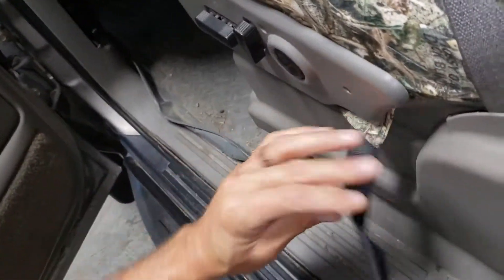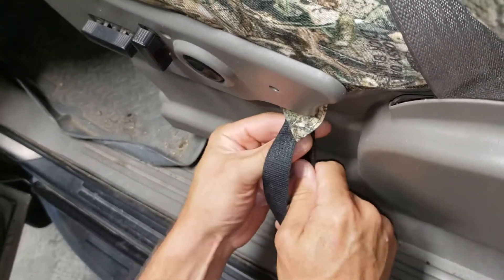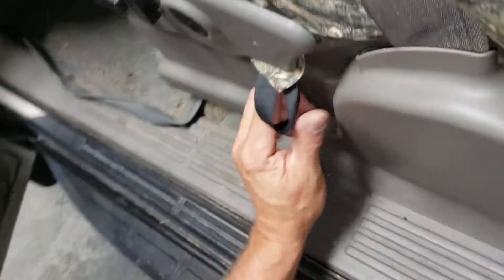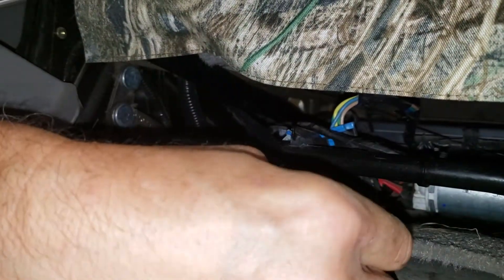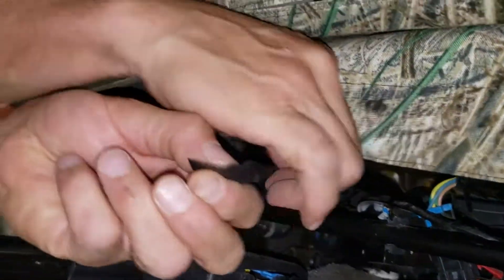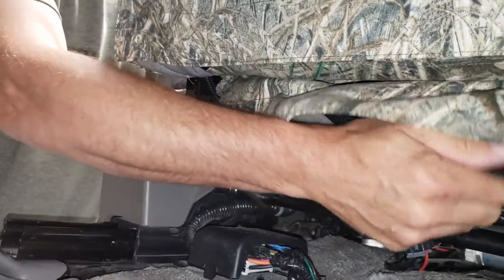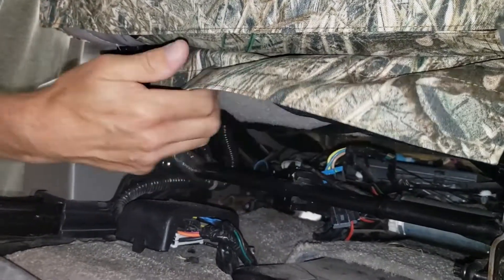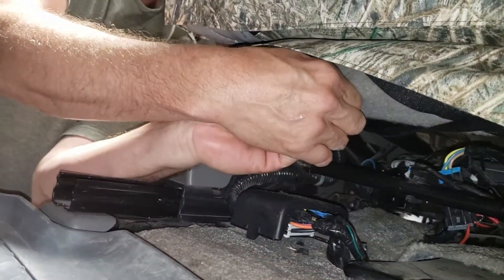Route the outside edge velcro right up under the plastic, exactly where it's sewn on — this is an easy one. Poke it in, carefully reach your hand underneath, grab that velcro, and it pulls right through the gap in the seat. Pull it tight, then pull at about a 45-degree angle and connect it to the fuzzy carpet on the back edge.